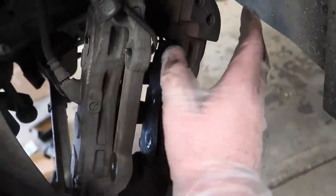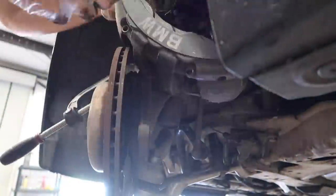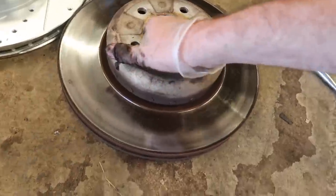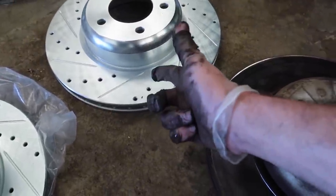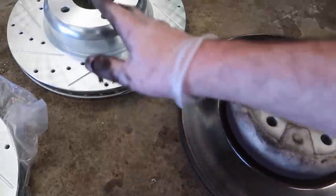Even though the plates are still on, the material has basically disintegrated off. So we're gonna have to get rid of these. We want to put the new brake pads on there and recompress the caliper. I'm going to use a C-clamp to show you guys how I do that. These rotors actually have a lot of life in them - they just have a lip. I'm pretty sure these can get resurfaced. I wanted to upgrade anyway so I ordered the new rotors, but these aren't bad at all - it's just the brake pads that are completely shot. Let's go ahead and throw on the new ones.